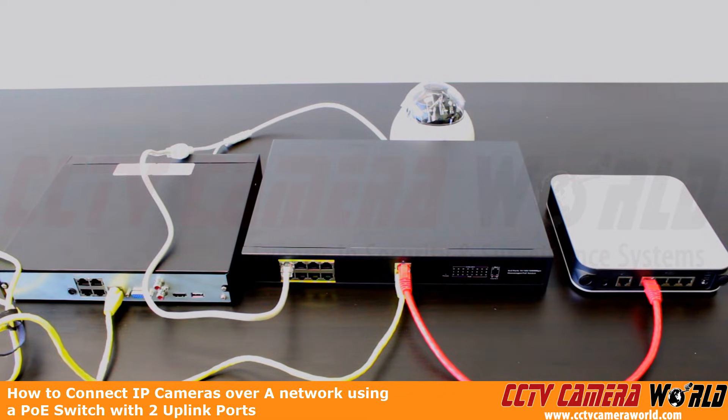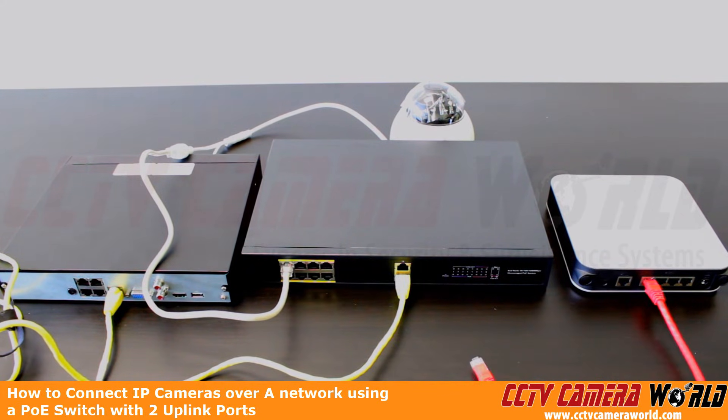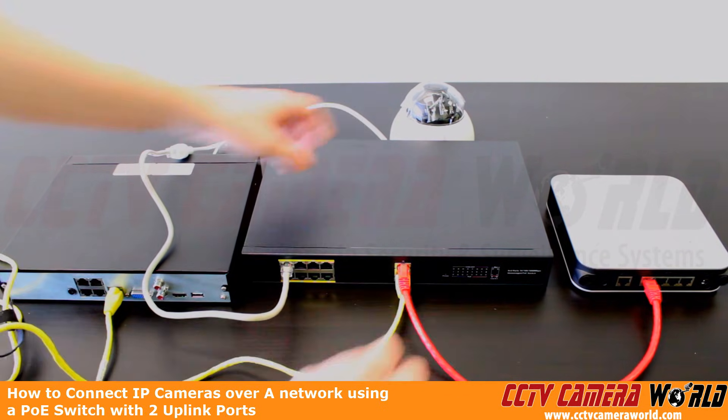Keep in mind, in this setup you can also use the NVR in standalone mode, where you can only access it via the monitor attached to the NVR. For this, all we would do is disconnect our router and keep it out of the equation. Now we just have a standalone system where the NVR is connected to the PoE switch, the IP camera is connected to the PoE switch, and the switch forwards data from the IP camera to the NVR. In this standalone setup, you cannot access the system from your remote viewing apps or from the Windows-based PC software. For that, you would need to plug in your internet router.